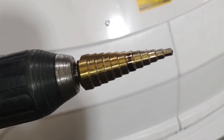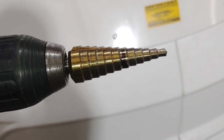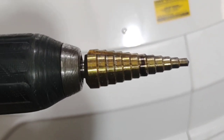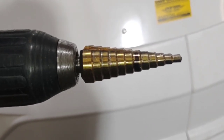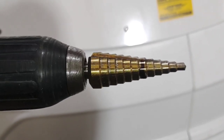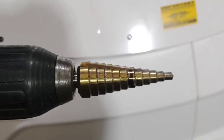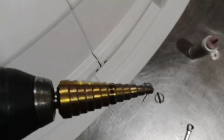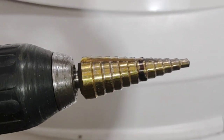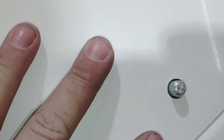When I drill out my hood pin holes, I need 3/8 inch for my 3/8 hood pins, so I use my step drill. If you use a regular drill bit, chances are the two flutes will rip right through and leave a jagged edge. By using a step bit, it makes a nice clean hole. Mark your step bit one size bigger — this one is marked at just over 7/16, so my hole will be 7/16. If you go exactly 3/8 for 3/8 hood pins, it's going to be such a tight fit that you'll have a hard time getting the hood open and shut. By oversizing just a hair — and note you will have scuff plates that go on this hood — it makes life a little bit easier and you can move them around a little bit if you need to. There you go — that's what it should look like. Perfect.